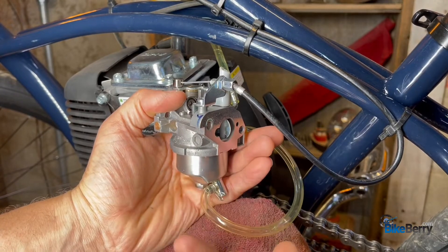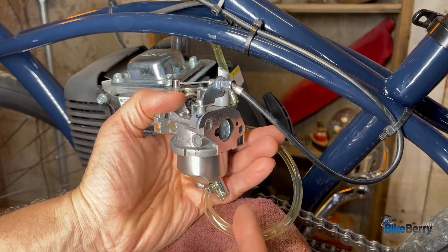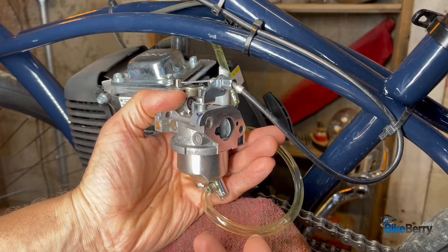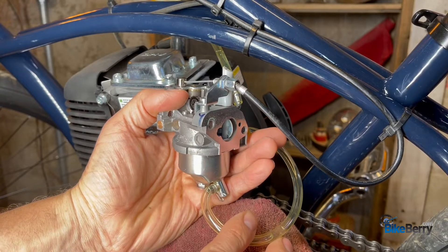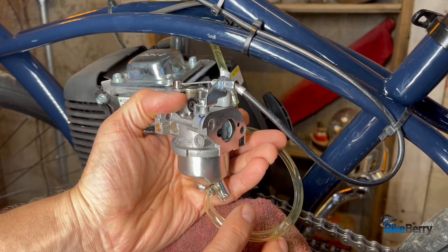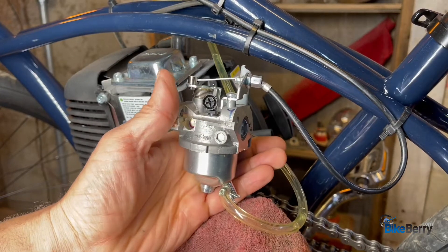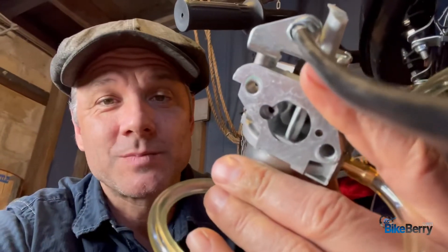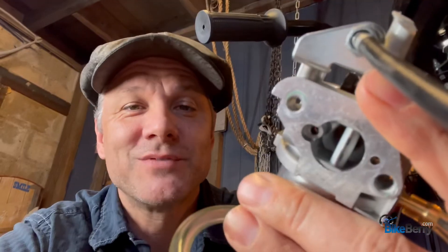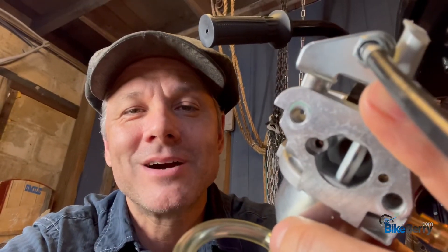You can open your valve and see if fuel spills out. Beyond that, if fuel is still spilling out, that means the needle is misshapen or the fitting it fits into is damaged — it's just not going to seal. You're better off ordering another carburetor; this is a pretty inexpensive hobby, so new carburetors aren't that big a deal. But that should get you going because that's really how it all works. I hope this helped you understand how the carb works. Comment below if you've had this problem or if you've got other solutions. Let's roll.